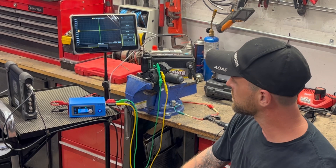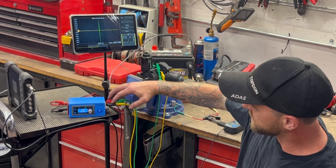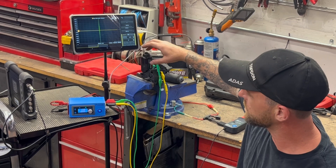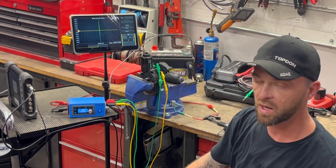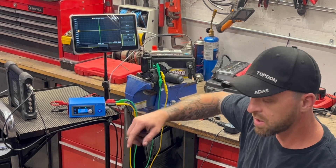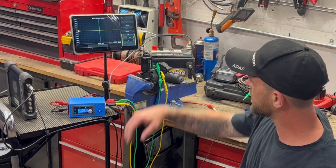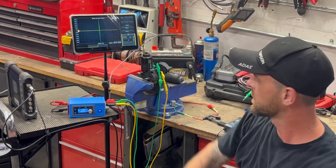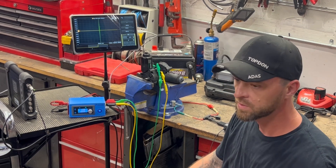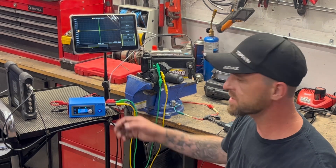It's got the variable voltage, but it's also got the pulse width modulation control - that's where these leads are. I have this hooked up to the pulse width modulation and hooked up to that headlamp actuator. On the back of the box, that's where if you just wanted to supply a steady voltage, that's where you would hook these leads. There's also a little switch right here - you can toggle and switch the polarity. What it does is it'll spin the motor in the opposite direction. Say you're working on a window motor and the window is stuck and you want to get it down - you've got to switch the polarity. This is basically a power probe on steroids.